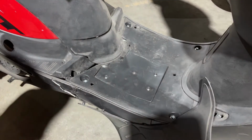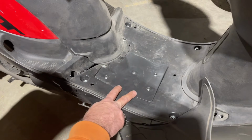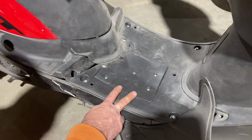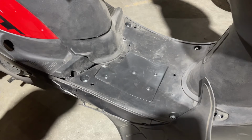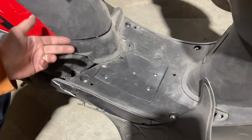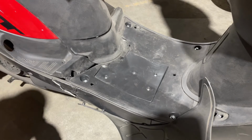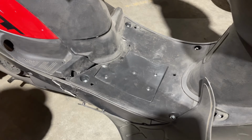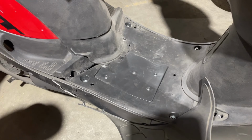If you're going to be leaving this sit in the winter time, you're gonna wanna pop the battery out of it and just put it on a battery tender, and it'll take care of it. And you won't have to worry about it then. And then right when the season starts again, go ahead and pop the battery in. If you live in a place like California or like Vancouver here, and you can ride year round, you don't need to pop the battery out of it during the winter, because it stays warm enough that it'll be fine. And you're most likely going to be riding it anyway, so you have nothing to worry about there.